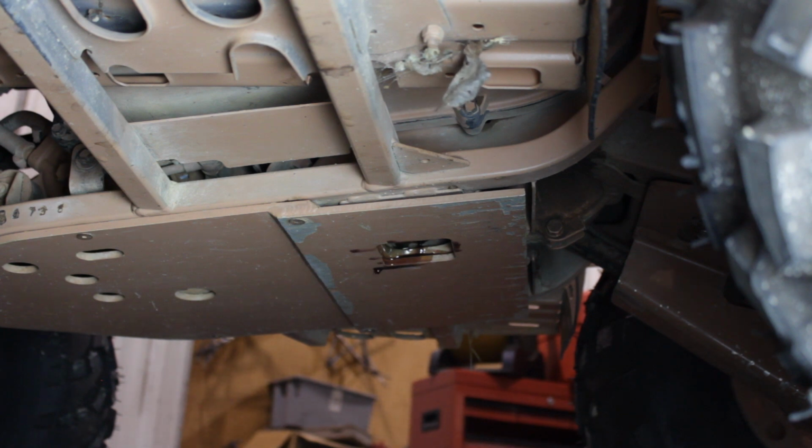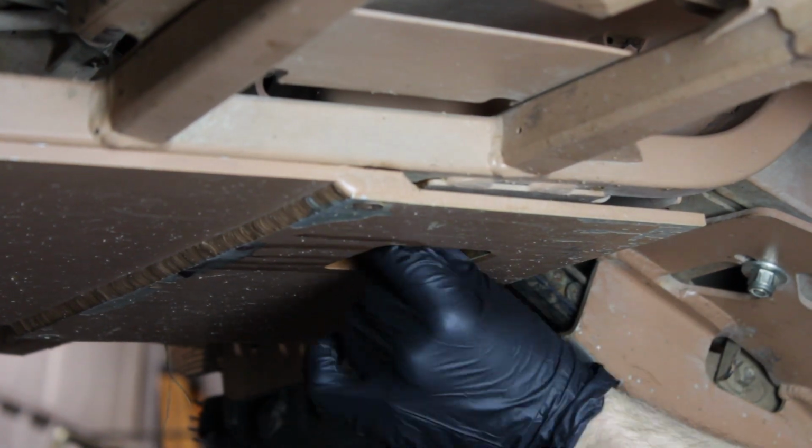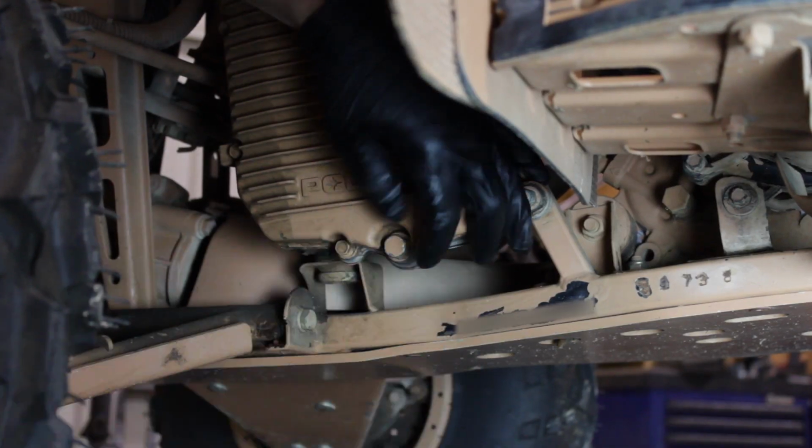You want to replace it if it's damaged or missing. On another note, when draining the crankcase oil along with the tank oil, you want to replace the oil as soon as possible to prevent any oil pump priming issues. That's very important here. And we'll just torque this down to 21 foot-pounds.